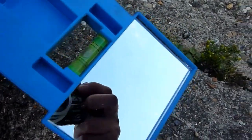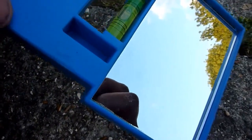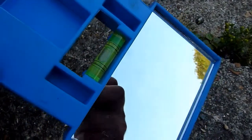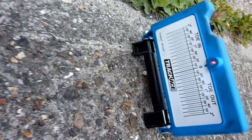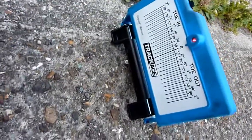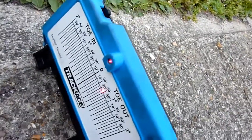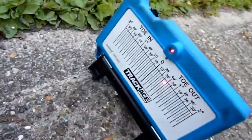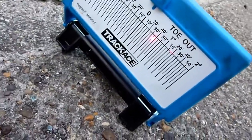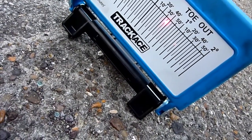So last thing. There's my unit there — a rotating mirror pointing downwards. Careful not to change anything, don't want to come out of alignment. It's probably way off. So this car should be zero toe for a Ford Mondeo. Now we're on toe out 35 minutes.